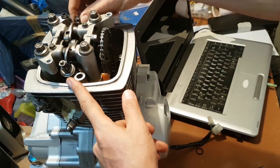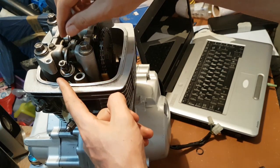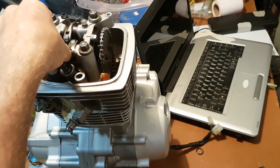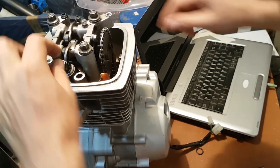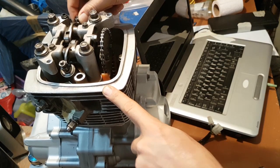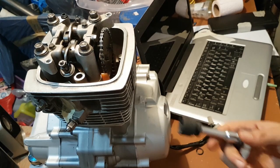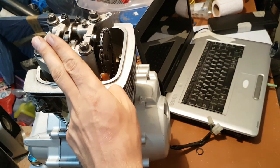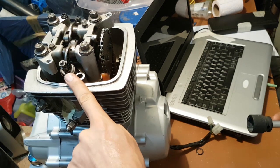The rocker arms should have a bit of play — a bit of game in them — and this is actually necessary. From the sound you can understand that they have no compression on them. So at this moment the engine is at top dead center. Now I'll show you how you can get fooled by the notch while the engine is on the exhaust stroke.